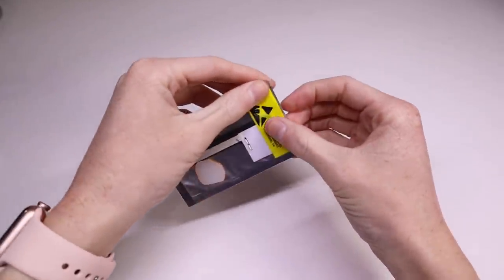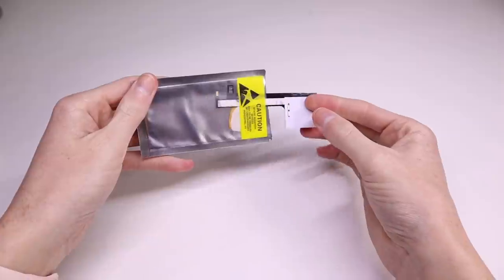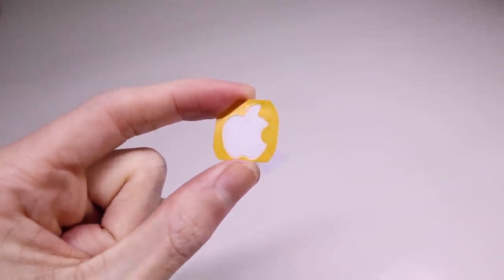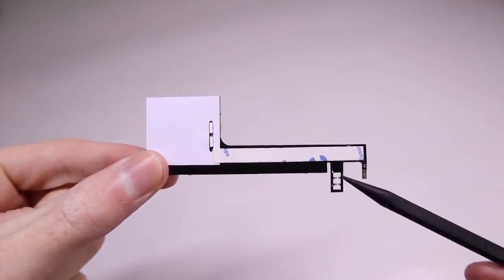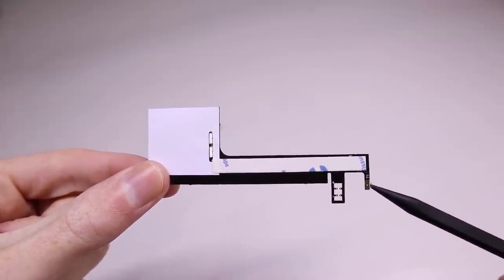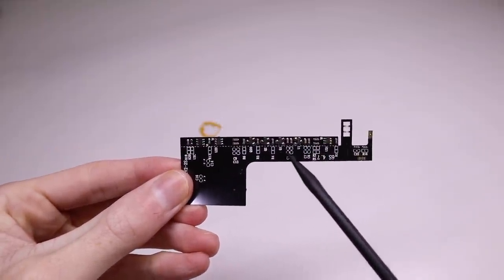The installation guide isn't very thorough and the English is quite poor and hard to understand, so throwing that aside it's time to install this LED logo. Included in the box is a clear Apple logo and also the module itself, which has a battery tab on it so it taps into the battery line, as well as a middle tab which connects to the speaker, and the two LEDs which will be powering the light itself.